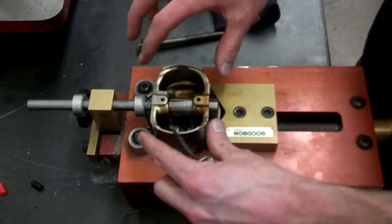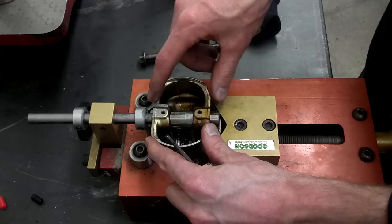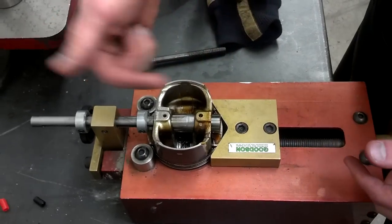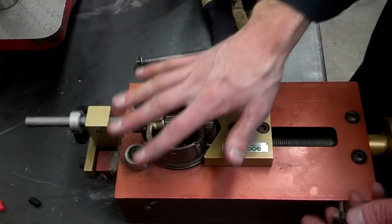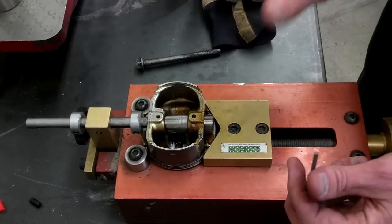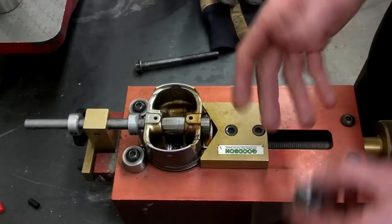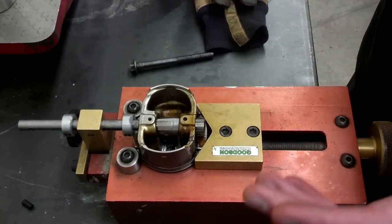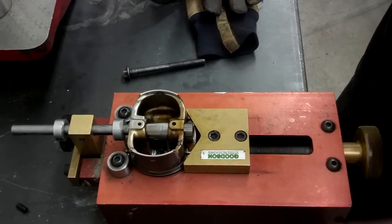Something to be very careful about: when I set this piston in this fitting, I looked at the top of the piston and made sure that the front of the piston was pointed towards me. That's very important. If you put it on backwards, you may not get a second chance. This whole operation has to be done perfectly or else you have to press them apart again, and that often ruins the piston. So you really, really get one chance on this and you want to make sure that you do it right.